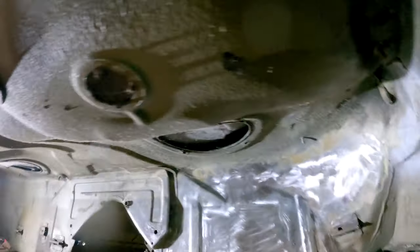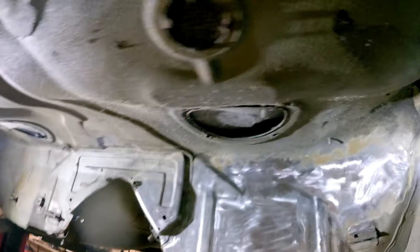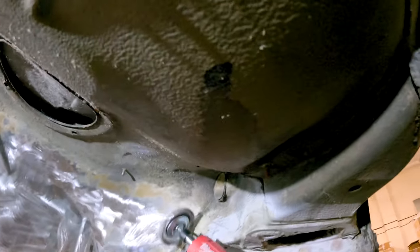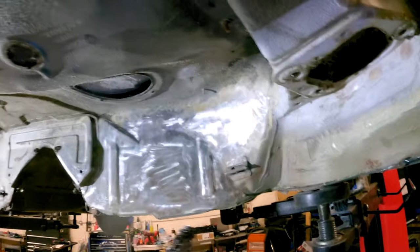Okay, this is quite slow progress, which I did expect. This tool does seem pretty good. It's nice to use. This isn't an advert for Milwaukee. But it keeps hitting what I think is thermal cutout. It's probably asking a bit much of this small thing, which means I can't keep getting stuck in, especially on thick stuff like this. It slows it down too much, and I think that's building too much heat in the motor, and it's turning it off. So that's slowing progress a bit.